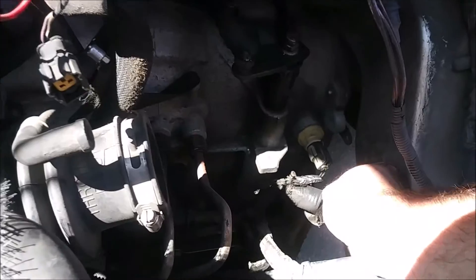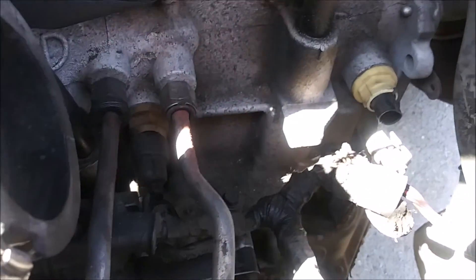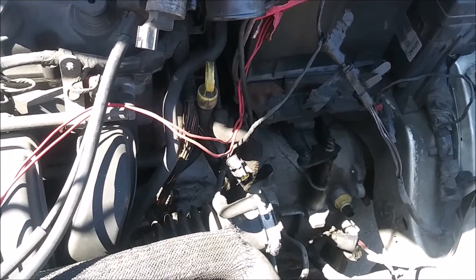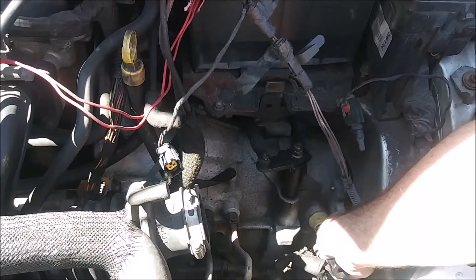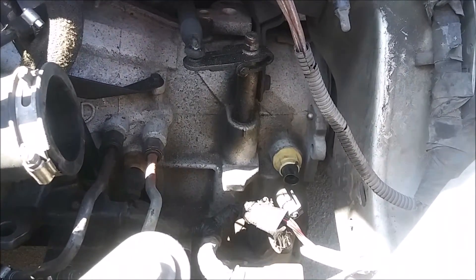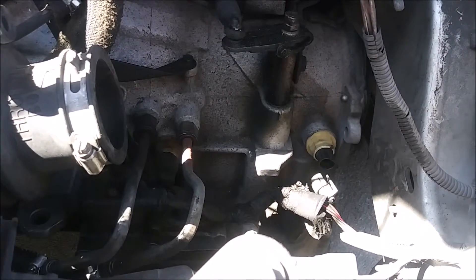This is our speed sensor — output. I believe that's probably going to be the input speed sensor. You'll need a 1-inch socket in order to get over here and remove this. Do take note of the orientation — if you have paint, you want to paint-mark it — because that needs to connect on there, and this is plastic. If you go too tight you will crack it and break it.